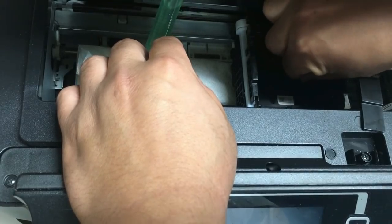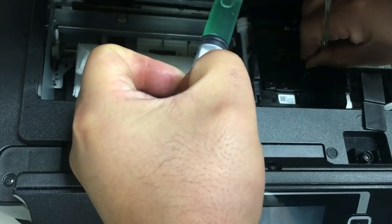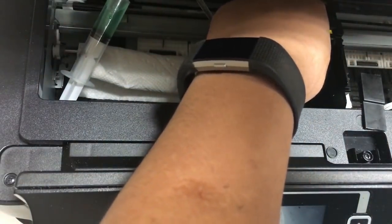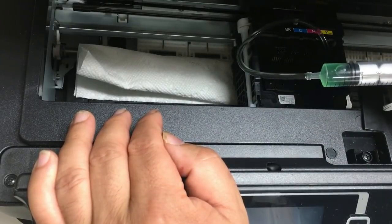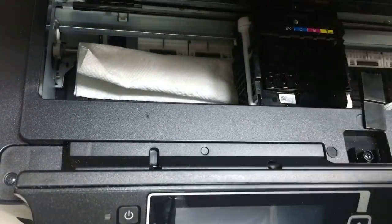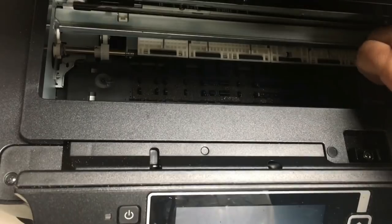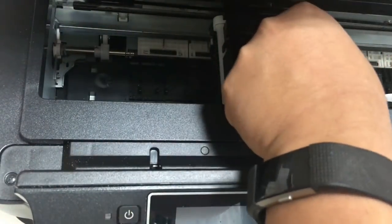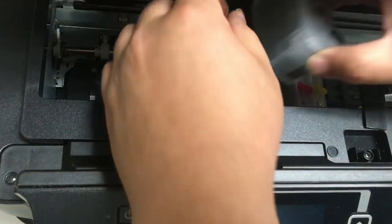We fit one end to the ink intake and the other to the syringe. Always squeeze — but remember not to squeeze too hard. It's like half the force you'd use squeezing a lemon to make lemonade, but twice as hard as an old lady squeezing a peach. You're going to feel the printhead open up, and then you can inject consistently with the cleaning solution. You can see it's a nice breakthrough once it's unclogged — now you can gradually push the cleaning solution inside.